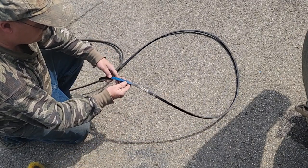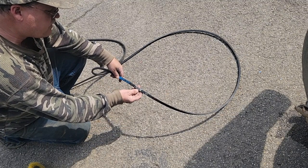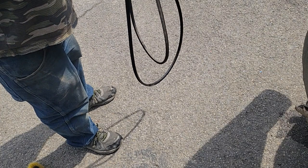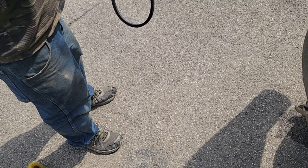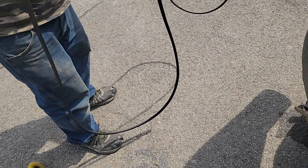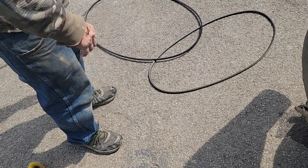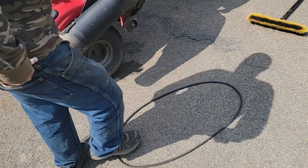So this one that I bought is the DD power drive 104 — I wonder if it's 104 inches. If this is 93, see what difference we got here — there's a whole lot. So I got to find a shorter belt by about 12 inches or so. I'll keep looking, I swear I bought one. But now that I know I have a mower deck belt, maybe I'll check that out and put one on — that's a little easier to put on.